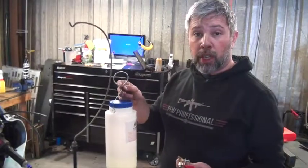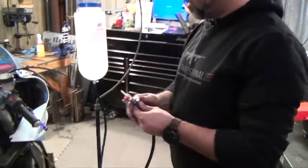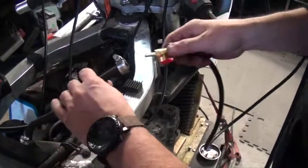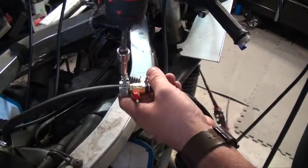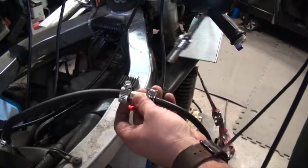To use the auxiliary gas tank, you must use a stand that's higher than the bike itself. You'll take the fuel valve and find the fuel line that goes directly into the carburetors or the throttle bodies. You'll insert it into the line itself, then use a hose clamp and tighten it down just enough to prevent it from leaking.